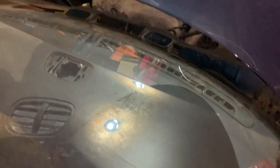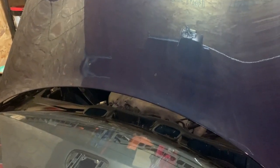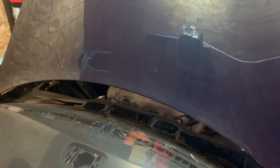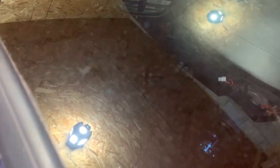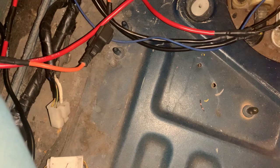What's cool is I plugged the stock ECU back in and now when I turn it on, it starts and the fuel pump's going, which is great - that is an improvement. I think the throttle position sensor is all out of whack because that's what was going crazy when I plugged in the other ECU. I don't need a jumper harness anymore for the fuel pump relay, and I can probably loom this all back up - though I'm probably going to rewire it again, so not yet.